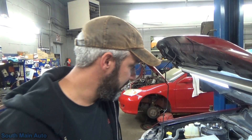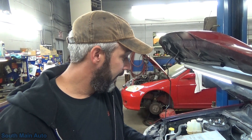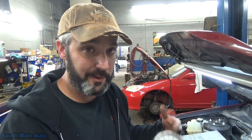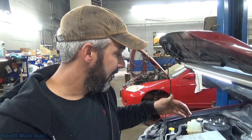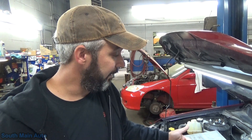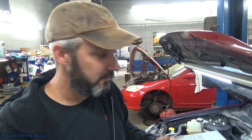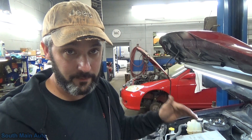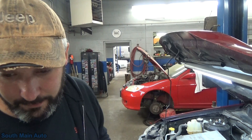The main point of this video: if you get one of these in, make it your habit to check the purge solenoid to see if it's leaking. I've seen some of these failures on these Fords where you actually have to cycle it two or three times to catch it in the moment when it actually glitches. Make sure you're testing the purge solenoid — particularly on NVLD systems — cycling it a few times to make sure it's not sticking. Particularly if you smoke it and you don't see a leak but it's got a hard code and a pending code. Cycle that purge solenoid multiple times to try to create the fault. Don't smash it with a hammer — but these are super common on these.